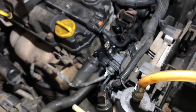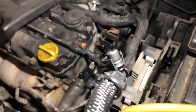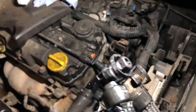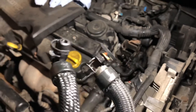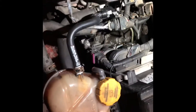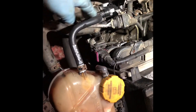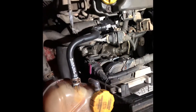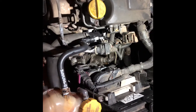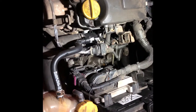That's how it came out of the old housing, but with the new pipe you can see it's a lot prouder and the seal is in a lot better condition. When you see them compared next to each other the difference is night and day. So we'll replace this pipe. Now that we've replaced the pipe going to the top of the expansion bottle, we've done another compression test and it's holding its pressure with no visible loss of coolant.